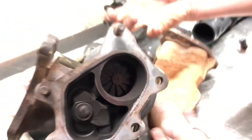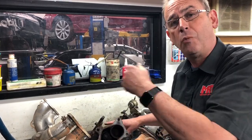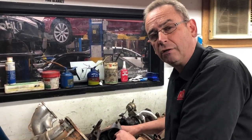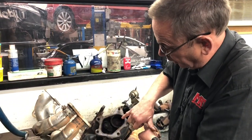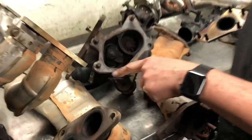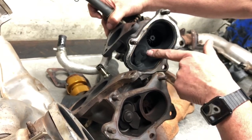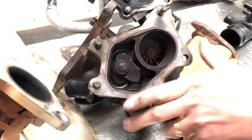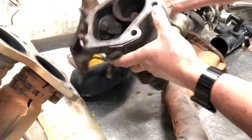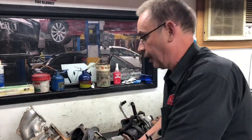One side of the wheel generates throttle response and brings the turbo on boost early by spinning the wheel quickly — that's the relationship of lag to generate boost. One pipe goes to the inside diameter of the wheel and one to the outside: one generates response and the other generates torque on the wheel to maintain boost when it's up and spinning. Because it's got two ports, it also has two wastegate outlets — notice the shape on the back is different. One single wastegate outlet versus two wastegate outlets — these open and close to control boost and manage wasted exhaust energy. The actuator on the arm is controlled by the wastegate control cylinder, which is in turn controlled by the engine ECU.